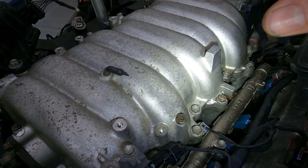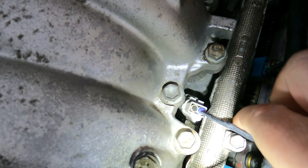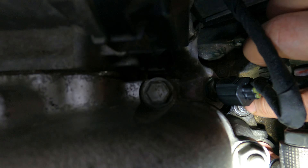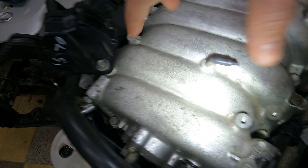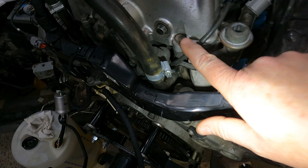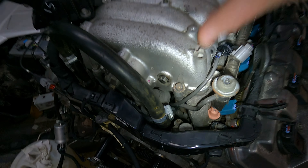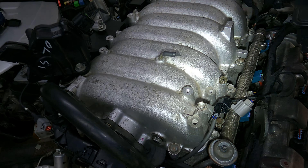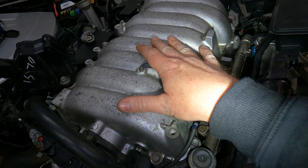A little trick: you don't need to separate the manifold at the middle joint. You've literally only got five bolts on this side and five bolts on that side, and the whole intake comes off complete. You don't have to separate it — take care of all the knock sensor wires and everything underneath, then put the intake back on, and that should be absolutely fine.